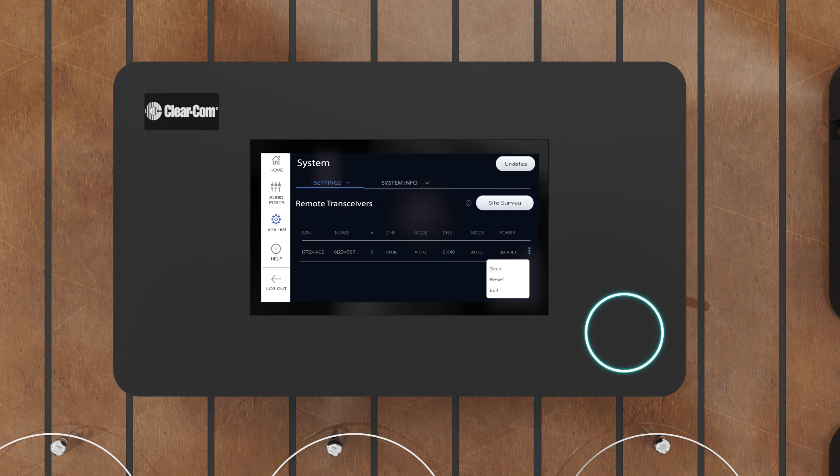Manual selection involves accessing the drop-down list and choosing Edit. Click the arrow icon to select a channel from the pop-up list, either DFS or non-DFS. Changes will take effect in a few minutes.